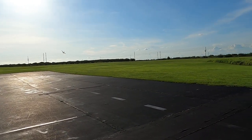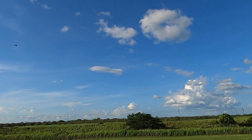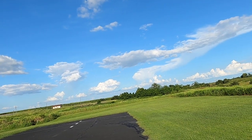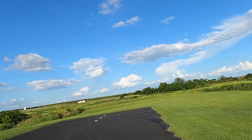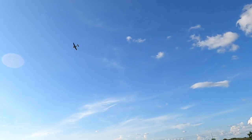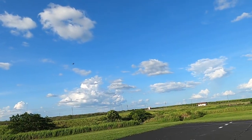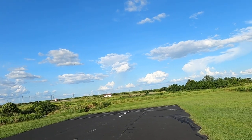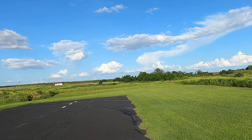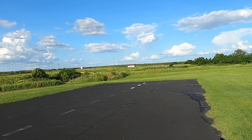There again you've got to stay on that rudder. Gear up. Unlike a lot of E-Flite planes that will run on 3S or 4S, this one will barely get off the ground on 3S. I mistakenly put in a 3300 thinking it was a 3300 4S, but it was a 3300 3S. I got her two feet off the ground and she just couldn't do it — I had to call it quits and land because it just would not fly.